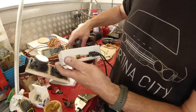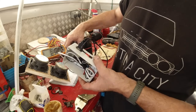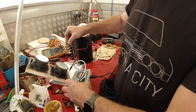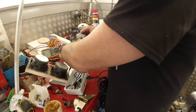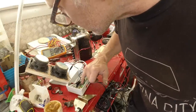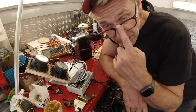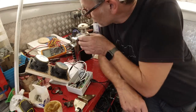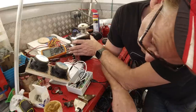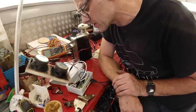Pressing the middle button gives Bluetooth - press again and that's auxiliary. Curiously the radio won't tune now - that might be why this module didn't end up going in the car. We've got just static normally. There's the antenna - you could press fast-forward and the module would do an FM scan, but it doesn't. This one doesn't do it when you press fast-forward and normally it would. I think this module's got a fault on the FM tuner.